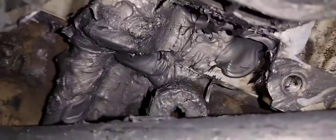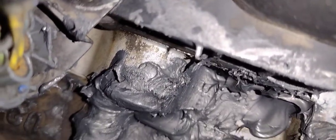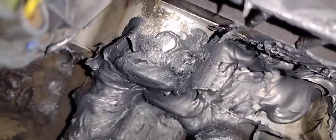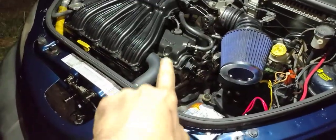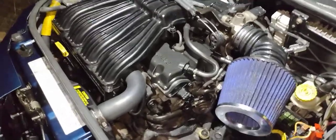It's gonna be hard to see, but there's a little thing in the way. I think it's got somewhat of a clear view of what that looks like. This metal thing right here is really hot, but that's what I did right there. You see the gasket portion — it's coming off a little bit. I think that's normal, but I just RTV'd that area right underneath here. It was just so tight and that's where the leak was. I used some RTV and it's been dry as a bone for like two days of solid driving. I went through at least a few tanks of gas and no problem — no leaks whatsoever.